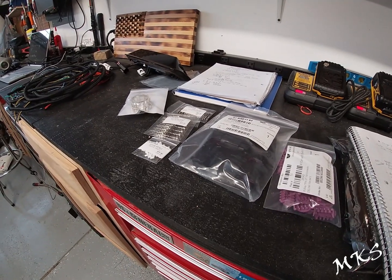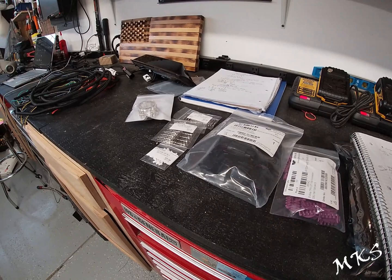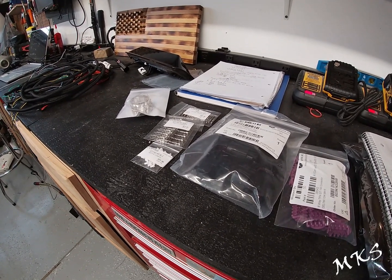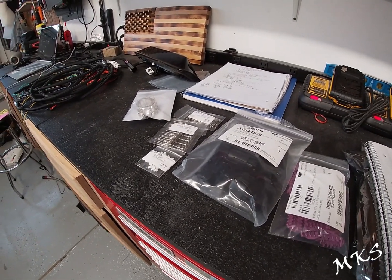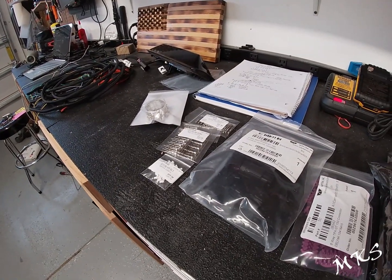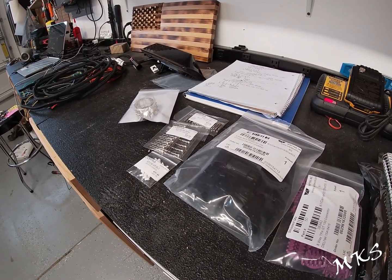This is very similar to a lot of the other harnesses you can buy out on the market. But you're basically going to pin 3 connectors, and one of them is going to start at I-370. I-370 is located up at the front part of the dash on the driver's side. It's a green terminal. It is pinned on the harness side going to the radio. It is already pinned with all the male pins.